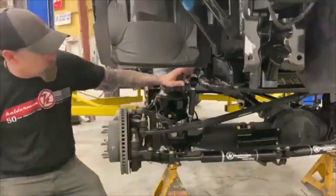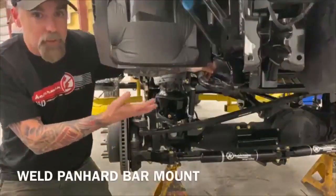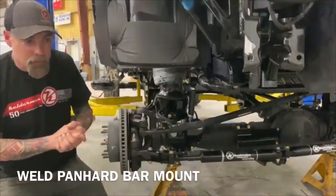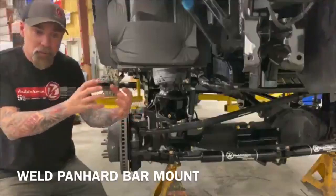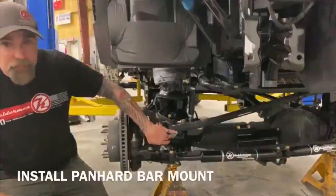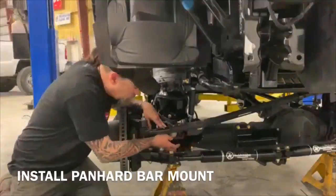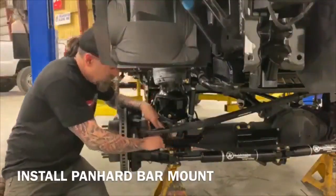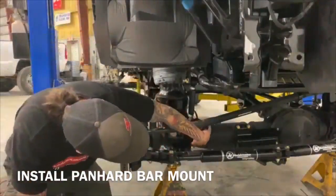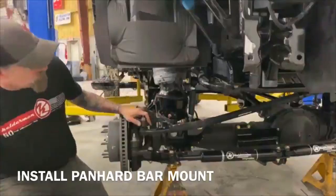So on the panhard bar drop — it does have a couple bolts in there, but we have to do some welding on it. You'll see there are a couple holes in the bottom that we weld to it. We're also going to weld it around the crossmember because there's a lot of stress on that thing — that's why it comes so far underneath the engine crossmember. On the opposite end, you're going to use this factory panhard bar bolt here. It's a two-piece setup with a bracket on each side; the bolt's on the side, and we have a spacer that goes in with the factory panhard bar. All this gets fastened together to provide your lower mount for the adjustable track bar that we provide.